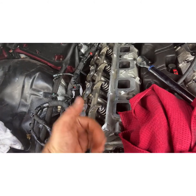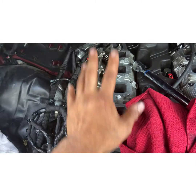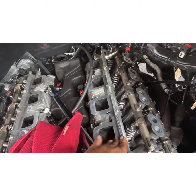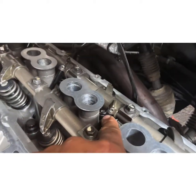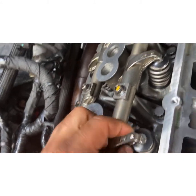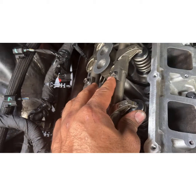The way the head gaskets are put on — this is the left side, which when you're facing it will be the right side. You always sit behind the wheel to determine left or right. Now I'm about to torque down the rocker arms. Make sure all the intake and exhaust pushrods are in — the longer ones are exhaust, the shorter ones are intake — and make sure they're sitting on top of the valves.